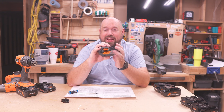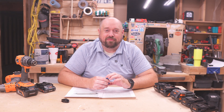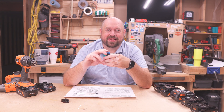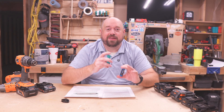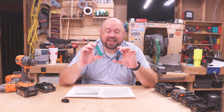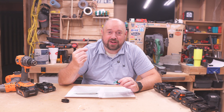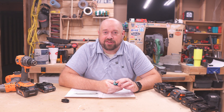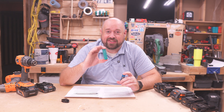That's what we're seeing in this 4 amp hour battery from RIDGID. Previously we've talked about two common sizes of battery cell types being 18650 or the ones that are seemingly going to be in more high performance batteries, which are going to be 21700. But fundamentally both of these sizes of cells are going to operate the same in that they're going to have discrete tabs that are wired to the internal structure of the battery, and it's going to be the single connection point out to the terminal on the battery. So there's going to be limitations on how much energy can flow in or out of the battery, and there's going to be inefficiencies in terms of how these cells operate.